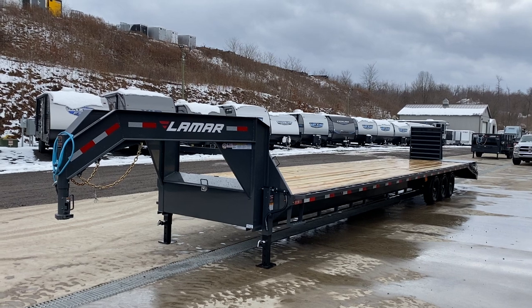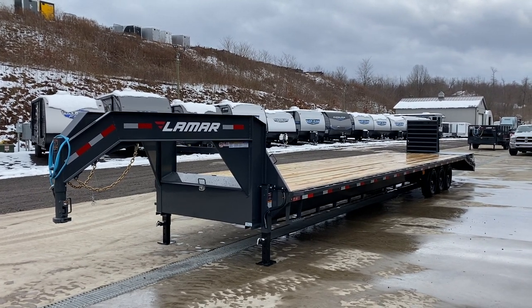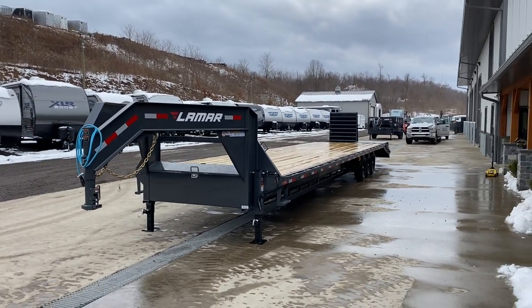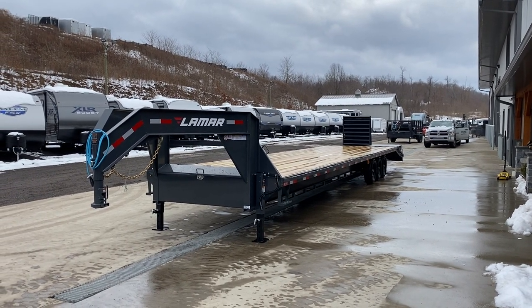It's going to give you about 13,000 trailer side and 4,000 or so truck side, giving you about 17,000 pounds total. You'll scale it to get a better idea. Normally on a longer trailer like this, your tongue percentage is going to go up a little bit, and then the triple axle will take it back down just a little bit.